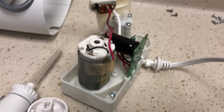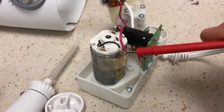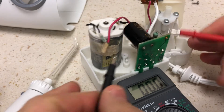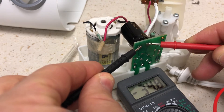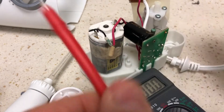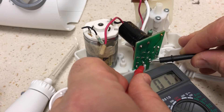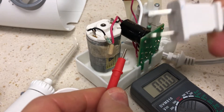After a bit of tinkering around, we figured out what's going on. It all boils down to this guy right here — there's a fuse. Let's just check the cap — it's still energized, it was up to 160 volts DC. You can see it's still up there, 150 or so — you've got to be careful with these. The traces lead down to this, which goes to the motor. I'm getting a nice reading, 140 or so still left. Remember, this is unplugged at this point — that's just the residual energy on the cap.